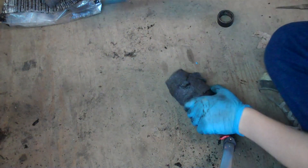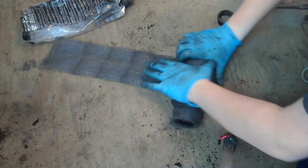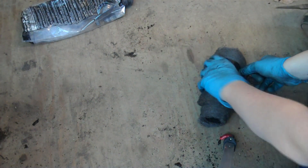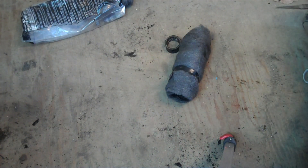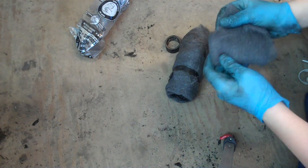So I've got it pretty good right here. I'm going to do a couple more rolls towards the end where it sticks in. I've used electrical tape along the whole way — there's a good reason for it: it helps compact the steel wool so you can fit more on. When it heats up it'll expand and just fill all those gaps you couldn't normally get. Try not to get any steel wool on your skin because it's like bees stinging you — it really hurts. That's a good reason for gloves even when you're just putting the packing on.